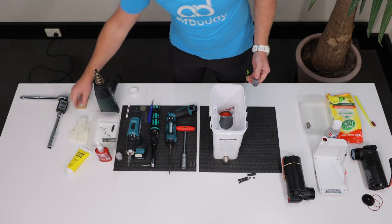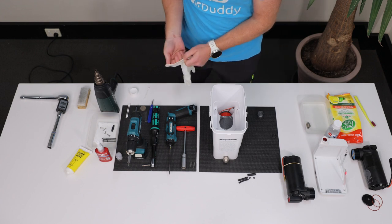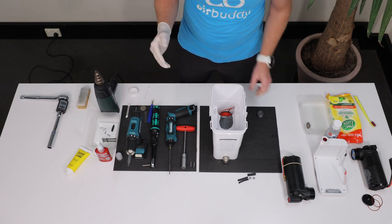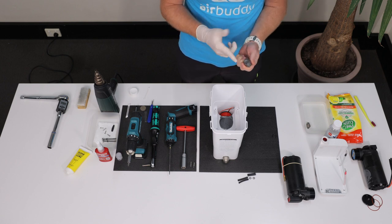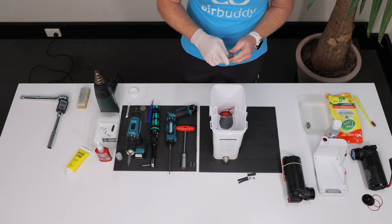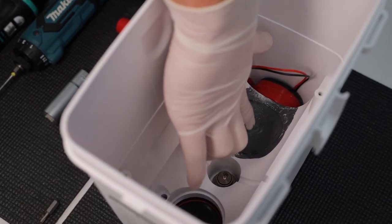At this point, you should restore the layer of heat paste on the heat sink. If the old paste is still okay, just add a little bit of fresh paste on top and spread it evenly. Or better yet, clean the old paste entirely with wet wipes and apply a new, fresh layer. Put on a disposable glove and spread a thin, uniform layer that is about 0.2 to 0.4 millimeters thick. Make sure to cover the entire area of the heat sink.